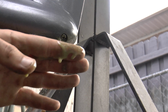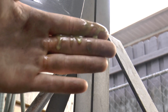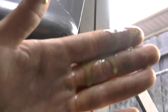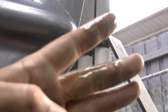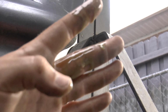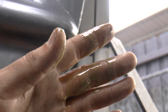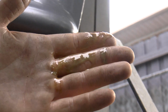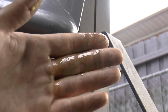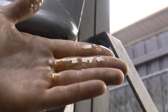After running this engine for about 2 minutes on the hose, the lower unit fluid went from perfectly clear to this white color. You see, it's milky. This means that this lower unit is bad. Well, the seals are bad in it, and the top seals are bad in this lower unit and not the bottom one. Just something to think about when you are replacing your lower unit fluid, to look for if you have water in your lower unit.